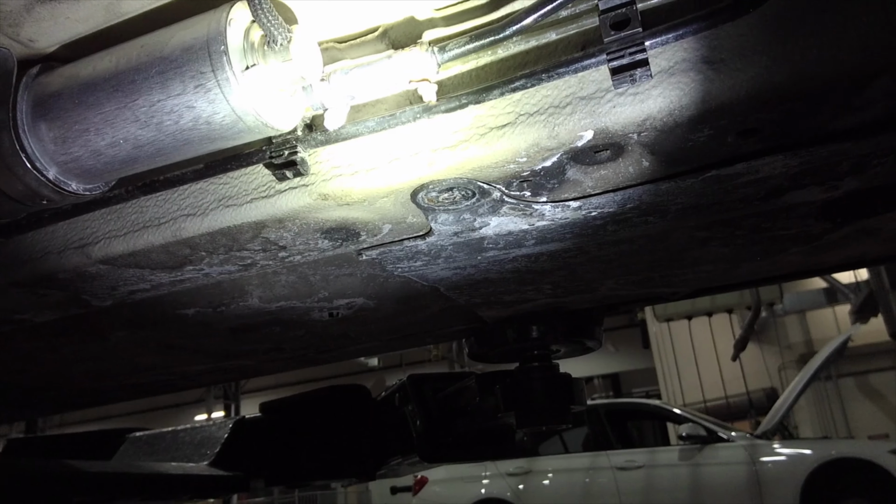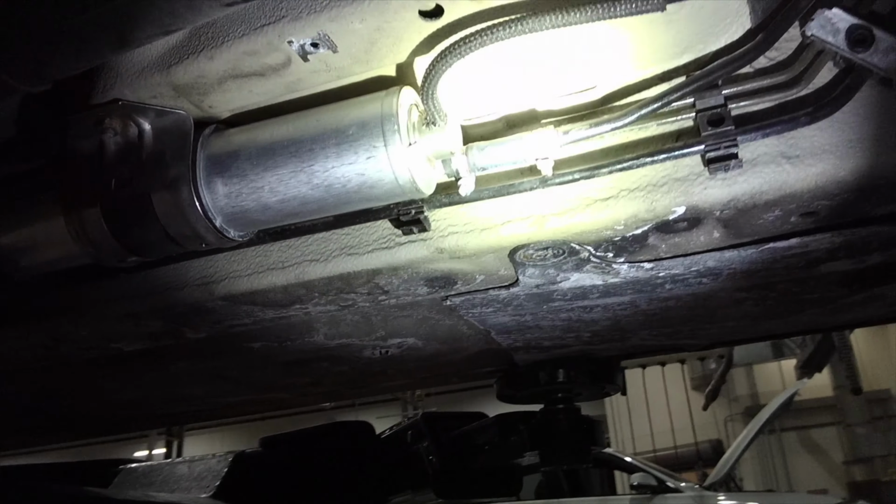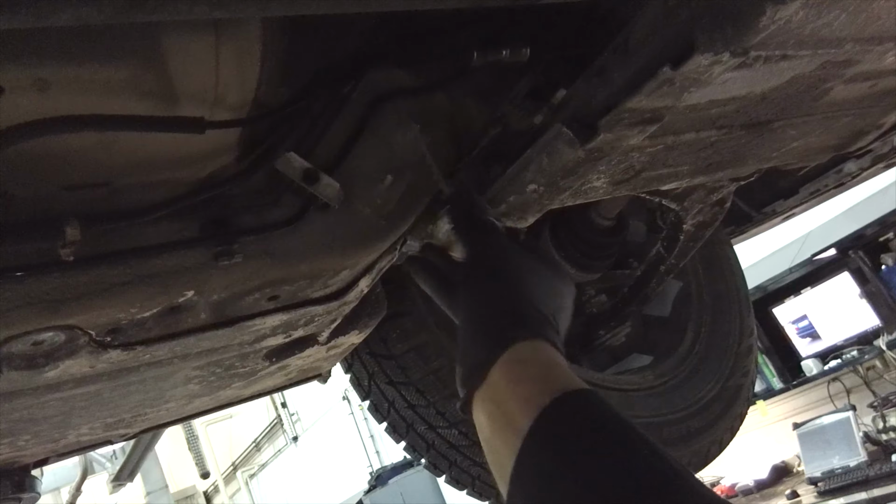After repairs were made, we started the vehicle with wide open throttle until the fuel reached the engine enough that it can idle smooth on its own. While the vehicle was running, check all filter connections to make sure there are no leaks. Use silver anti-seize on the body studs so that in the next service, the cover bolts won't rust on and will remove easy.